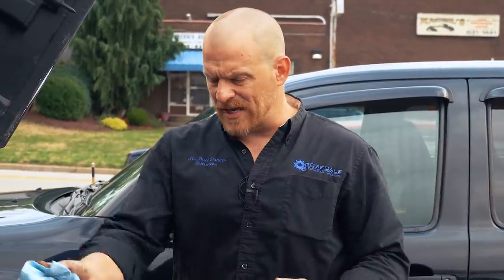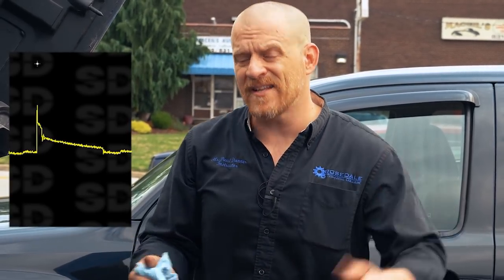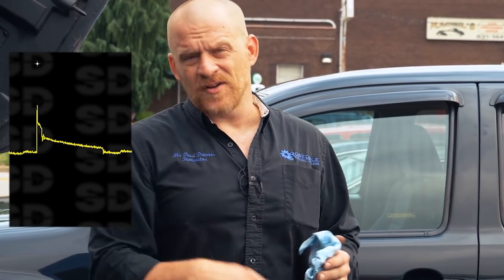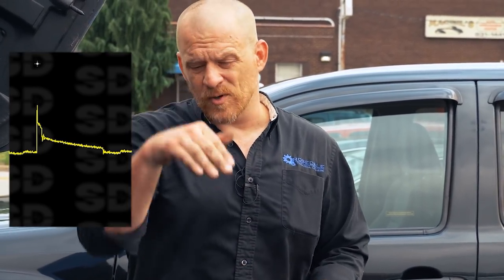We will get another final piece for you, a final running of this engine. That's pretty much it as far as identifying shorted injectors. It was nice to be able to see at least the ignition waveforms, in that I was not seeing a consistent misfire. I know we saw some of those downward spark lines, but that can also be from flooded conditions, and that may well be what's going on here with that injector. It's not spraying right, flooding out the number three plug, and that can give you that downward slope.